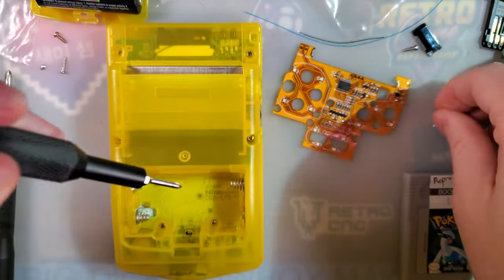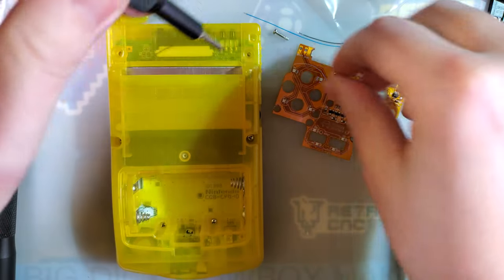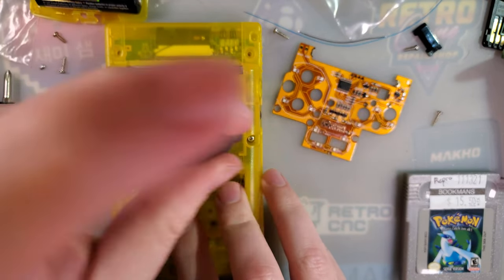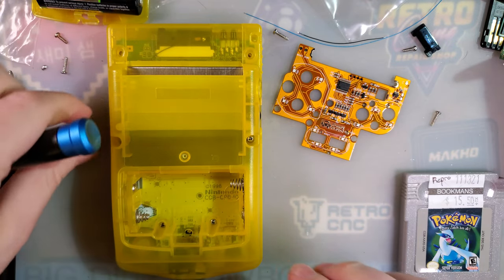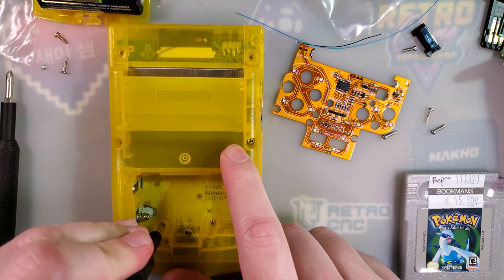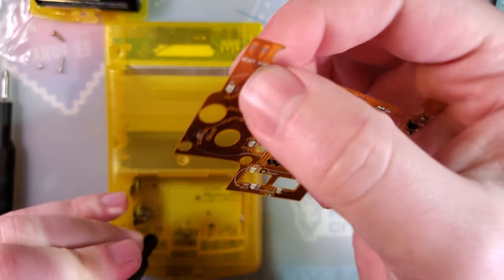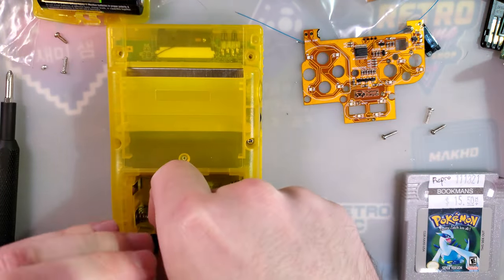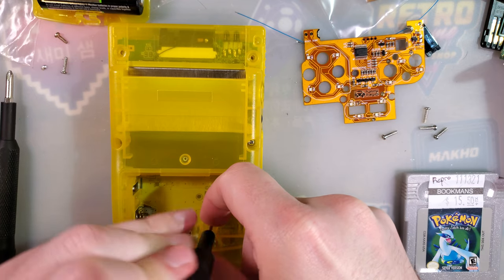Go ahead and pull it apart here. Soldering is required for this. Also, I mentioned this during the Backlight video I just did, but if you're installing a Backlight also, it makes more sense to install this first because up here we have two solder pads for the Start and Select buttons, and it's just easier to solder to those than the Vias that I showed for the install.